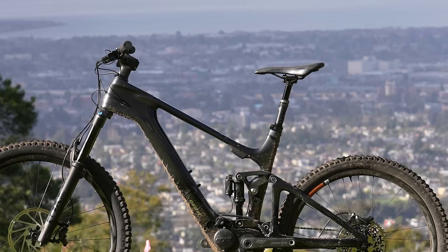The only discrepancy I see is the 76 degree seat tube angle. And this is really splitting hairs, but you think it's one degree slacker. If you use live valve, it would keep the bike from sagging in. So they're like, well, we'll put you in a more efficient pedaling position that lets you ride at a higher speed and use the suspension to hold you there. Whereas a steeper one would allow you to sag and still have some leverage against the bike. So I kind of understand the philosophy, but I don't buy that they designed that far.